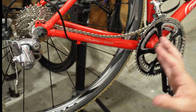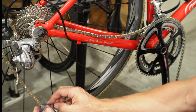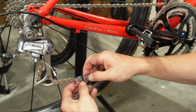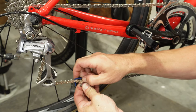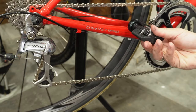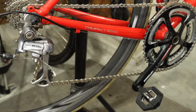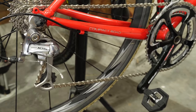Now that you've got the chain on your bike and you're ready to connect the master link, get a paper clip or you can purchase one of these tools — I'll put links down below — and just simply put it into one of your chain links. I recommend a couple links back on the ones in the back, and then do the same thing for the one on the front. This will give you a little bit of slack so you can easily connect your master link. Now that you've got your master link connected, hold on to it while you remove the little tool. They do make tools to reconnect these master links, but they are not necessary — only to remove them. To install, you just put your chain at the top with the master link up there, then hold onto your tire and quickly push on your pedal. And there you go — the master link is fully connected.